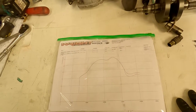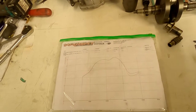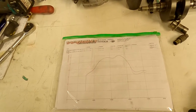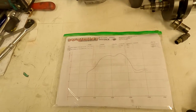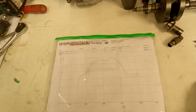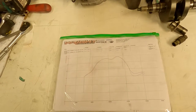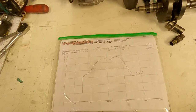However, if you've got an engine like this, or you're only ever going to practice, you can pick these engines up relatively cheap. And if you've got the tools and skills to rebuild your engine yourself, you can save a lot of money on servicing and maintaining your practice engine. The piston and gasket set for a top end might only cost 130 pounds — potentially saving yourself 200 pounds on each top end rebuild.